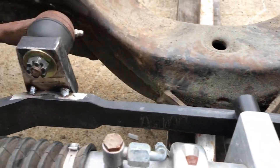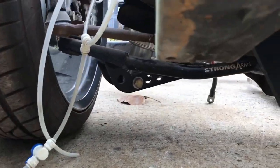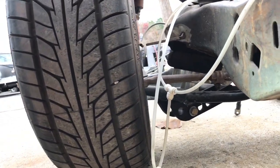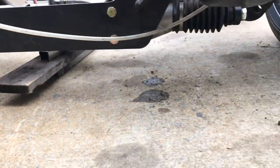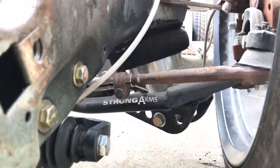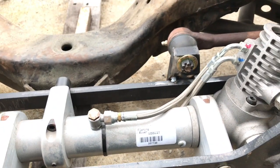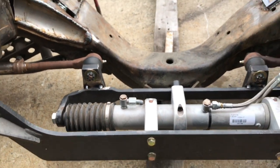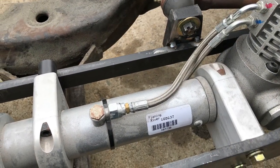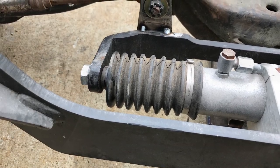I moved them also outward to kind of get the actual radius point even with the control arm inner connection — the lower control arm radius point. They're not really level right now, but my ride height is going to be a little bit higher than what you see, so they will be level at my ride height. That's where I'll align everything when I go put everything back permanently. I just have them tacked in to see if it's going to interfere with anything. Until I do my final mock-up, then I'll weld everything in permanently.